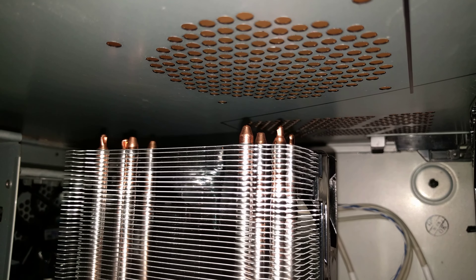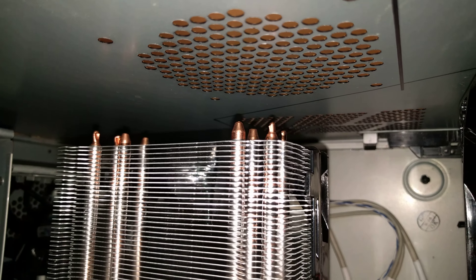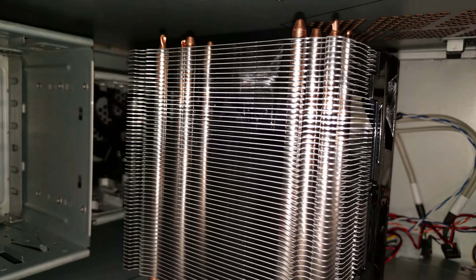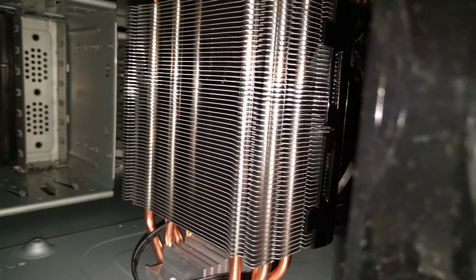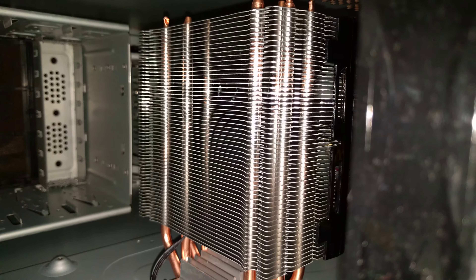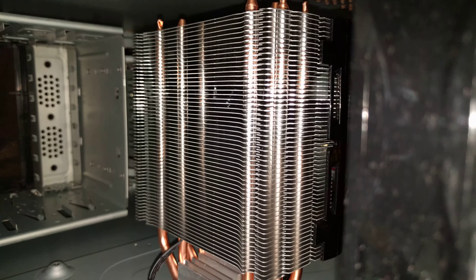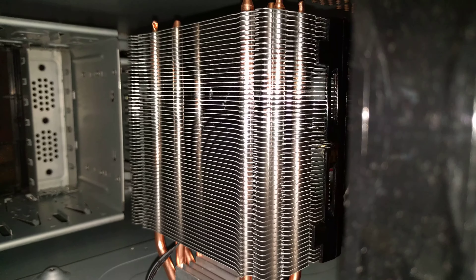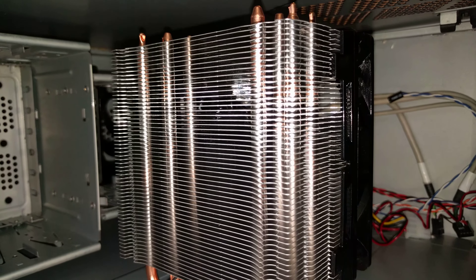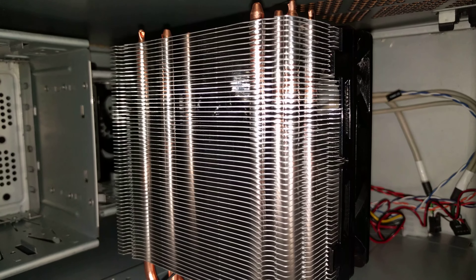So I guess we'll see — I do believe it's going to fit, just fit at that. Either way, this is a very good option for additional cooling on your CPU if that's something you're interested in doing. I don't think it's necessary if you don't plan to overclock your CPU. If you do plan to do some considerable overclocking, you can go this route, which is cheaper, or you can go the slightly more expensive route. I do believe Corsair has a number of liquid coolers varying in sizes that you can install pretty cheaply — that is another option.